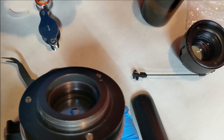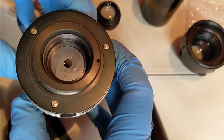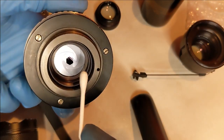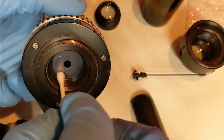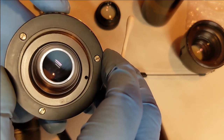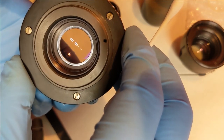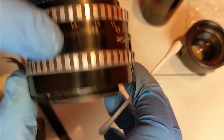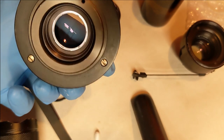I hope the aperture blades don't fall out at this stage — it's probably best to leave them open wide. You can actually clean them if you find some oil: just a cotton bud with a circular motion following the line of the aperture blades is completely fine. The cotton tip will absorb a lot of the moisture from any oil. So sometimes it's not necessary to completely strip down these lenses.